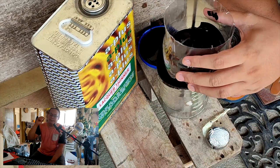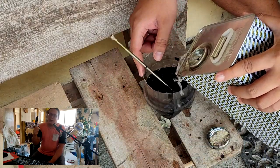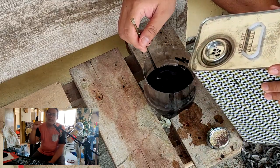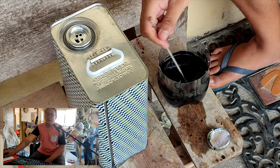At first, when you mix it together, the paint feels thick. Actually, it's not mixed well. Stir it a little longer and then you'll feel that the thinner and the paint have mixed and it's thin. I use a 1-to-1 ratio because I'm going to use a spray gun. This step is actually optional, but I'm just going to share it. Some people use spray cans, you can do that, but I just wanted it to look good and the paint to stick better, so I used lacquer, not acrylic spray cans or even the samurai acrylic with epoxy, if I'm not mistaken. So lacquer is the best.